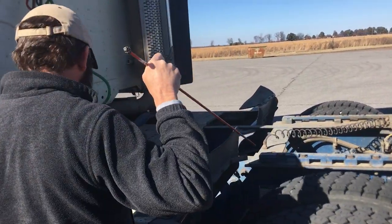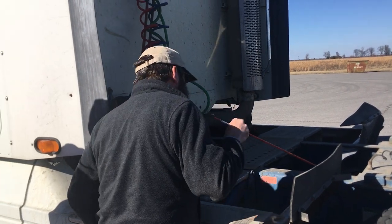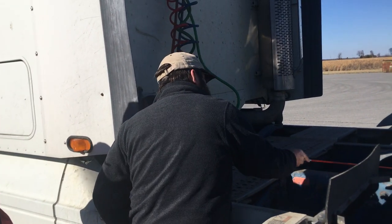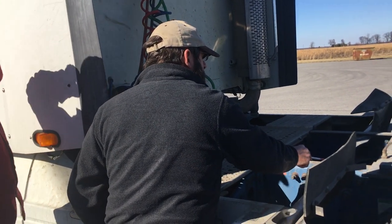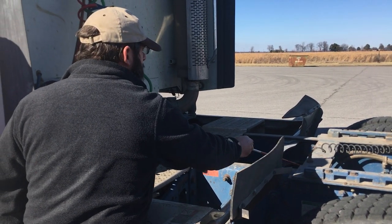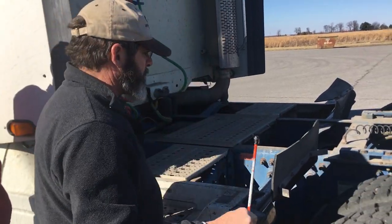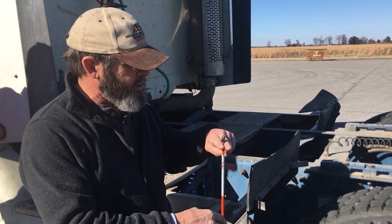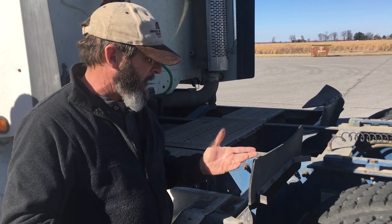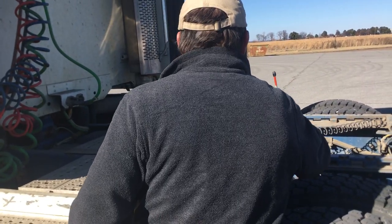For the braking system on the drive axle: air lines — if I had air supplied, make sure no air is leaking out, no dry rot, no cuts. Comes into my brake chamber — not cracked or broke, the band holding it together is tight and secure, securely mounted. What comes out of the brake chamber is my push rod, not cracked or broke, fastened to my slack adjuster with a pin and cotter key. If I had air supplied the system, it should not move more than one inch by pulling it by hand. My brake pads — not worn dangerously thin, not cracked or broke, no oil or grease. Brake drum — not cracked or broke, not misshapen, no oil or grease. Inter-axle seal — can't see it again, but if leaking it would show in my brakes, my wheel, my tire, and on the ground.